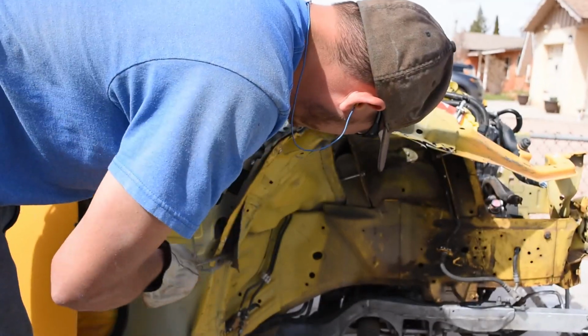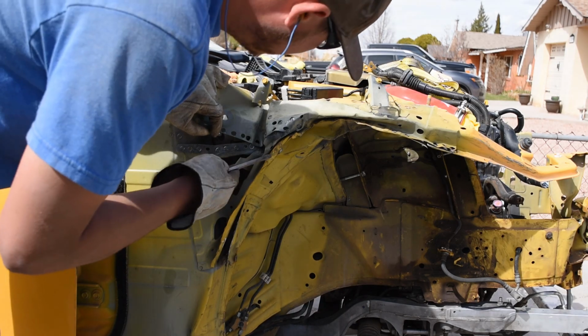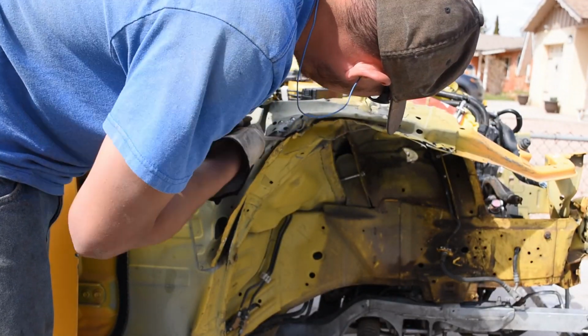Using a pry tool puts tension on the area and makes a satisfying snap when the spot welds are drilled through. I tried to take great care not to drill completely through the back so I didn't ruin the base layer of metal.